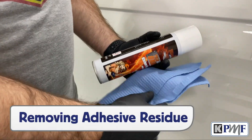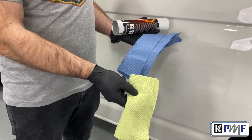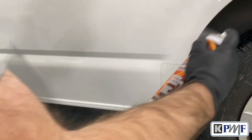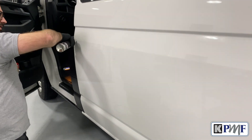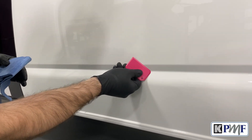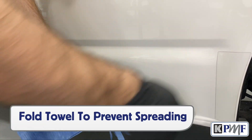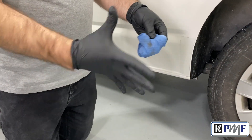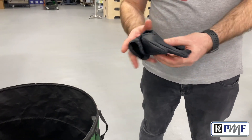If there is any adhesive residue left behind, use a quality adhesive remover that won't affect the paint of the vehicle and paper towels. Avoid using microfiber towels as the adhesive will become embedded in the fibers. Be sure to spray only where there is adhesive residue left behind in order to avoid overspraying, which can create a messy workspace. Adhesive residue will most likely be found in the recessed areas and on the edges, and this can also mean opening doors. Give the adhesive time to soften — usually about one minute. Using a plastic scraper designed not to scratch paint, like the yellow blade from Yellow Tools, remove the adhesive and wipe it onto the paper towel, always rotating the paper towel to avoid old adhesive being transferred back to the vehicle. When done, remove the glove while holding the paper towel, then remove the second glove around the first one — this will result in a clean workspace.